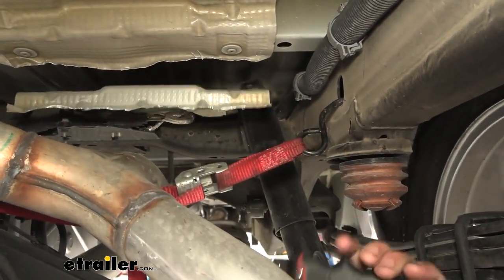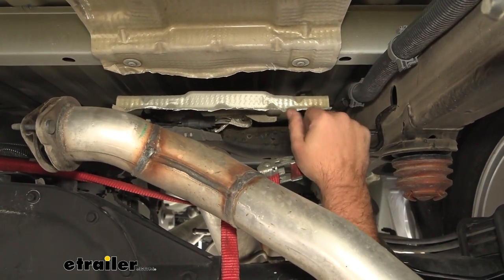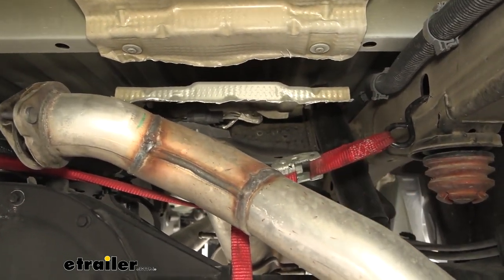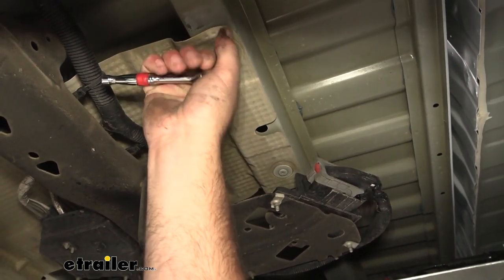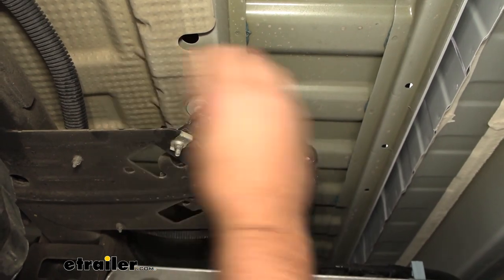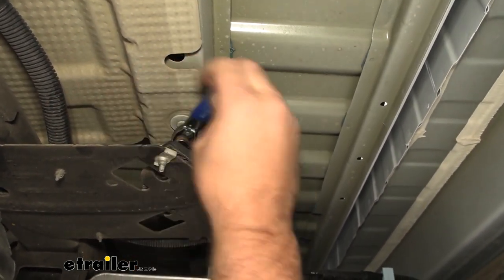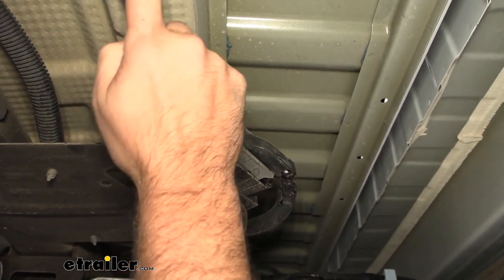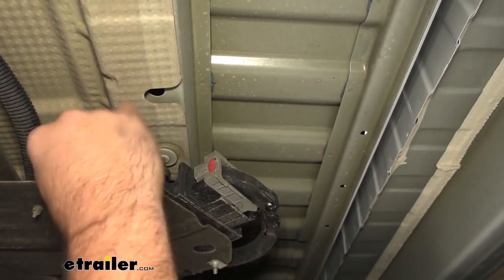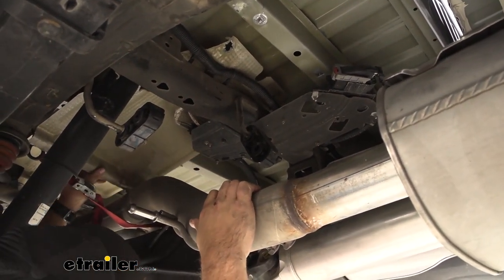I've gone ahead and made my cut. There may be some portions where I wasn't able to get a clean cut — we can bend this back for clearance or do some additional trimming. There are also two T25 torx bits up forward; the one tucked by the wire harness is a little tricky, so use a small ratcheting driver. Be careful not to round these out. Now we can remove this heat shield and get rid of it — we will not be reinstalling it.